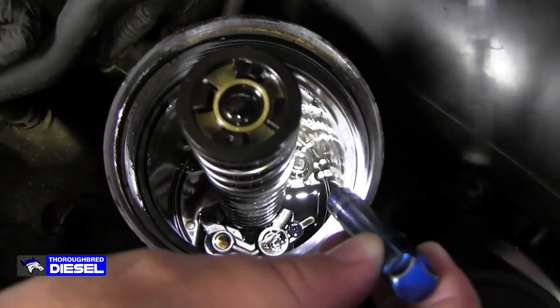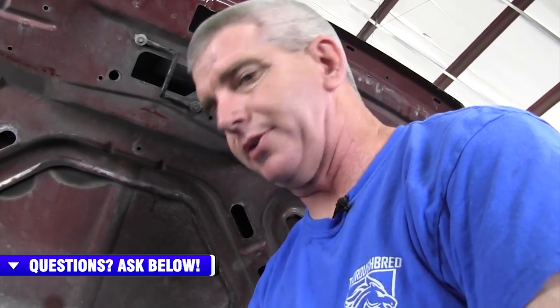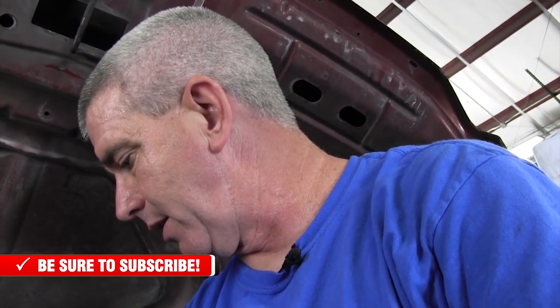So it shows you the valve and what we're up against. Very important to use the proper oil filters here. If you had continued to use the aftermarket setup, you've just got to stay there — you don't have the option to go back to the OE style filter. But to go into good OE filtration, get yourself the Motorcraft cap and Motorcraft oil filter and go back the way this system was designed. If you have a question about 6.0 oil filters or any of our other videos, just give us a call. As always, thank you for watching — please like and subscribe to our channel.